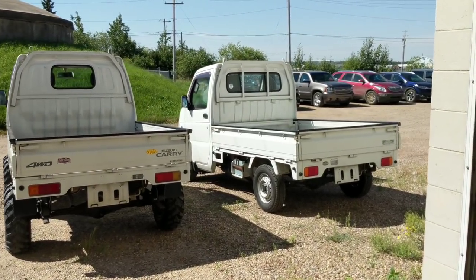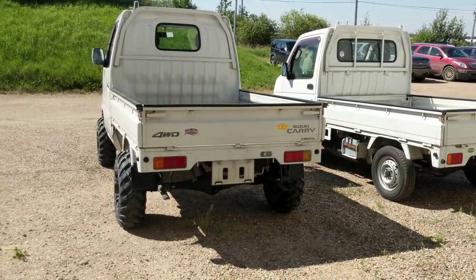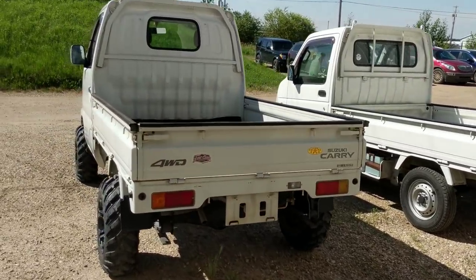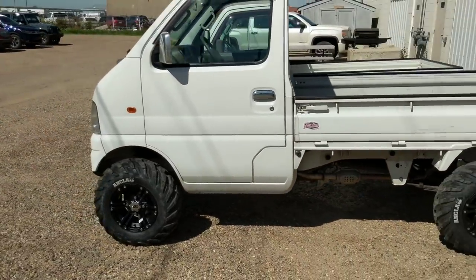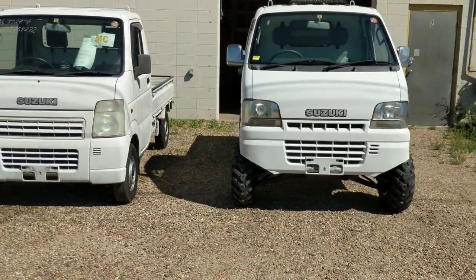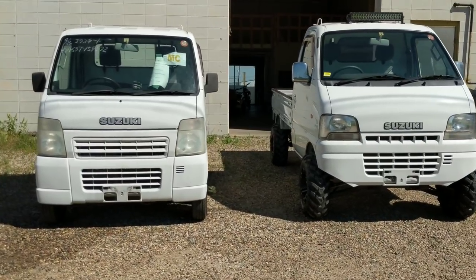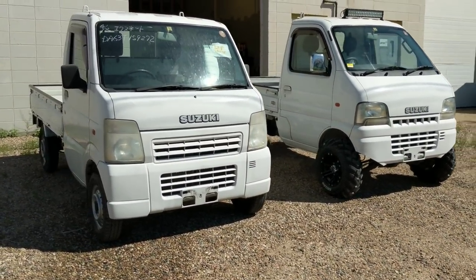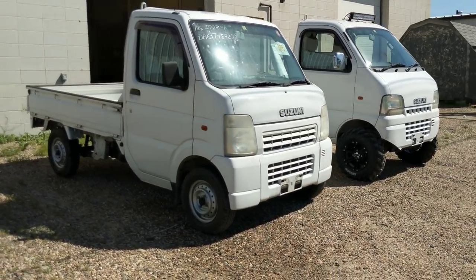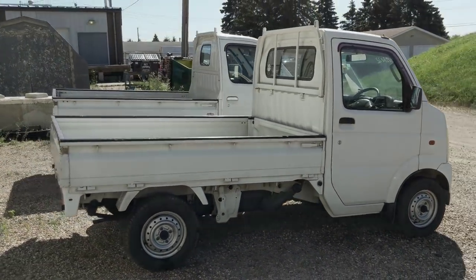If you've got a stock mini truck, they're a great little 4x4 machine — they work really well around the yard and are a good off-road truck. But doing a simple two-inch lift kit with a little bit of an oversized ATV tire makes a pretty massive difference in ground clearance and the overall stature of the truck. The low-pressure tires give better traction and a better ride, and at the end of the day it looks a lot better too. If you're thinking of doing some off-road modifications, go for it — it makes a big difference in performance, not just the look. Check out our website foursunsoffroad.com, subscribe, like the video, and check out our other mini truck videos.